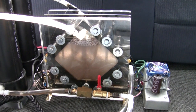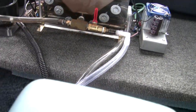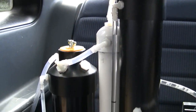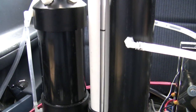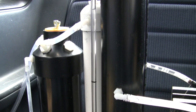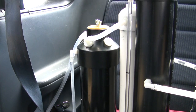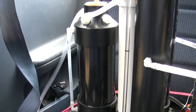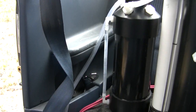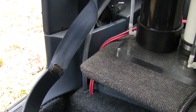Diamond shape. The plates are six by six and they are 316L. Got a quick drain here that runs out so I can drain the system. The white tube in the center is actually a catch can — it collects the vapor going into the bubbler that's full of glass beads that I bought at the dollar store. This is my bubbler, it's four inch, and it holds the water and keeps a flashback. The hose goes down and goes underneath the car along with the positive terminal going to the battery.